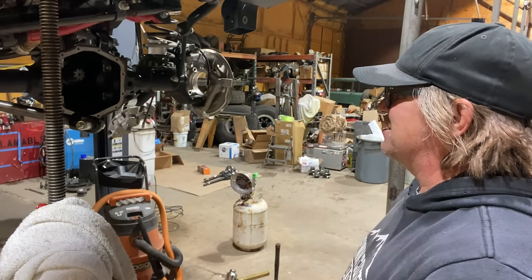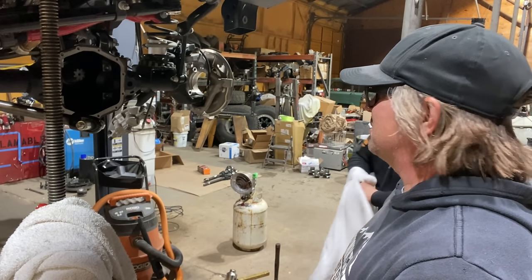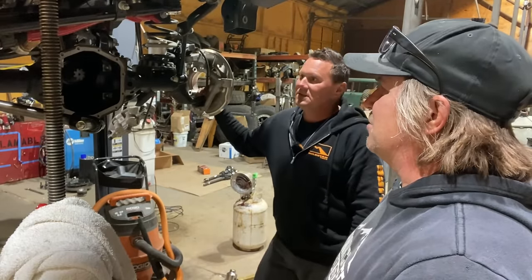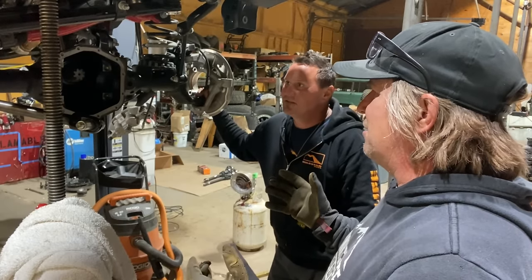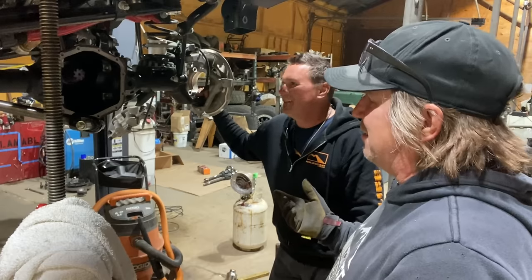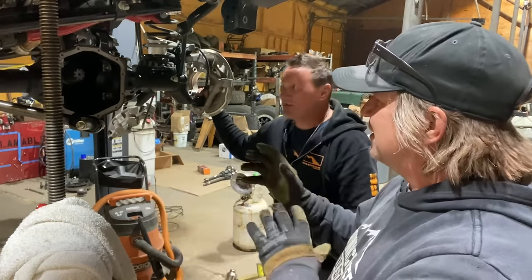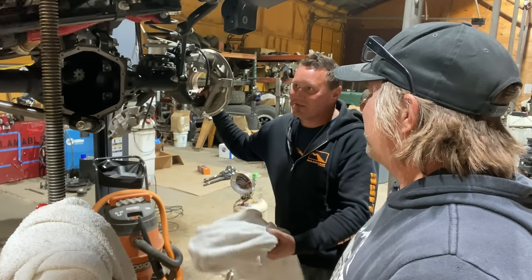That's the why. It's funny because it's all very scientific, but there's also a lot of feel and experience. Correct. I think that's the thing that always gets me sideways on doing gears. If it was just put slot A into slot B and then tighten to X, Y, Z, it would be like, oh, okay, but it's not. It's that plus, you've got to feel a little here. I don't know what your bearing preload should feel like. And you should know about the pinion preload.